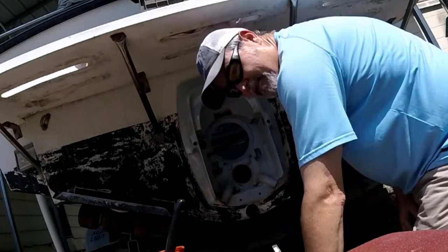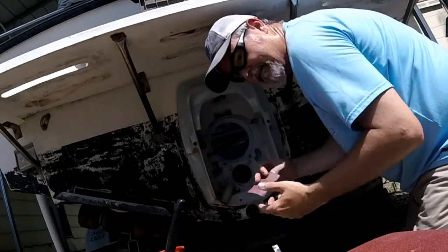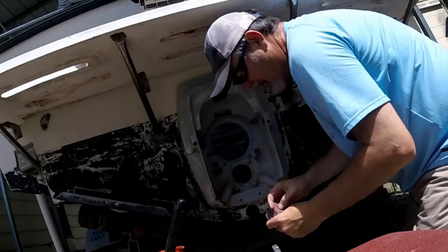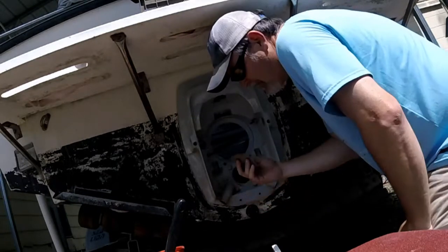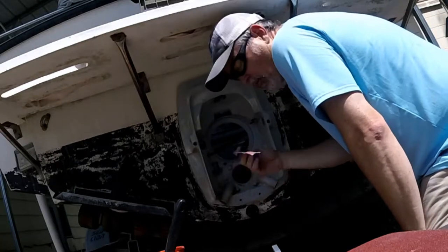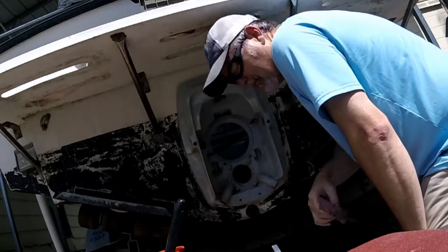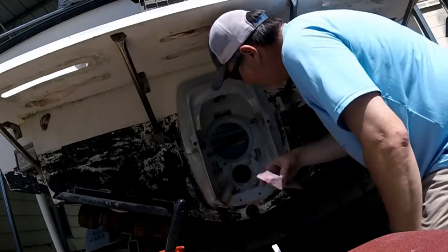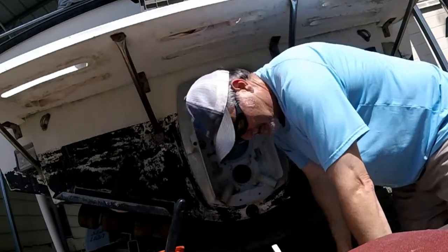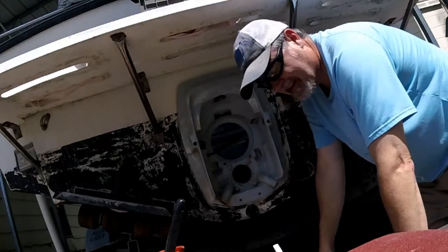The last thing I've got to do is sand it so I'll be ready to prime it. I got some 120 grit sandpaper. I like to use Rhino wet — it holds up very well, better than the hardware store brand. I'll put a link down in the description, and I'll put a link to all the paints and the primer that we're going to use. I got a little bit of it sanded already.